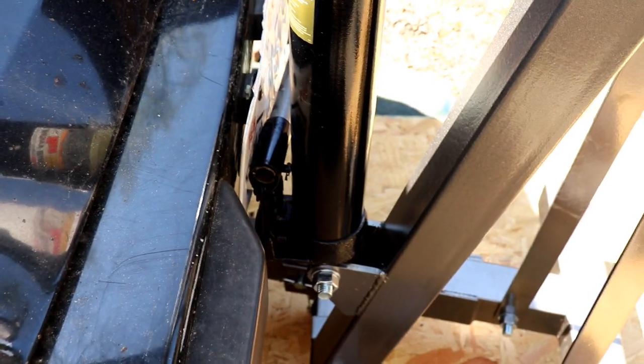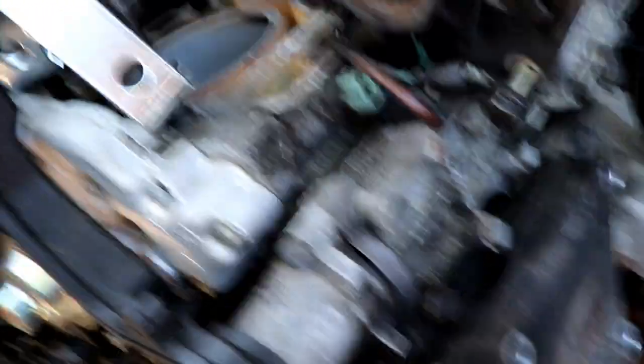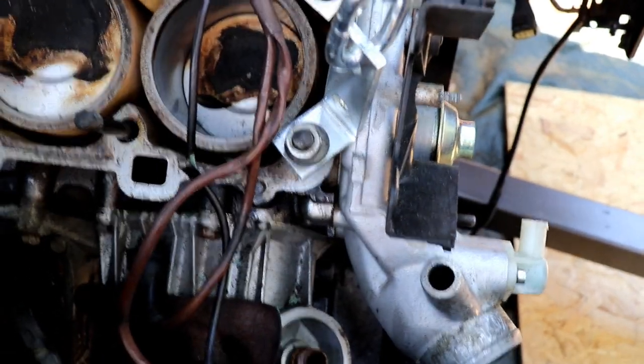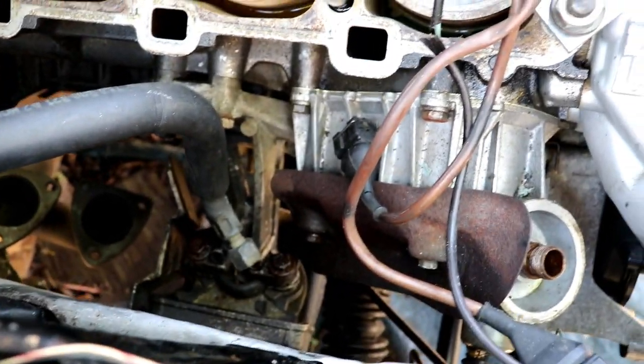As far as the engine stand goes, I've kind of never done this before. The boom is extended as far out as I can get it and it will not reach the rear engine mount, which is on top of the cam tower that's been removed. I've seen someone do it on the head studs and I'm assuming that's what these L-shaped brackets are for. I picked up a leveler yesterday from Harbor Freight — pretty good reviews and it's been easy to use. I've hit the motor mounts with some PB Blaster and I'm waiting for that to set in before taking those out.